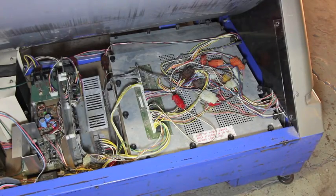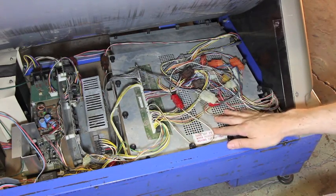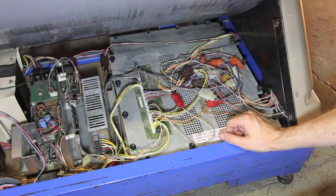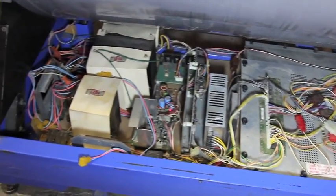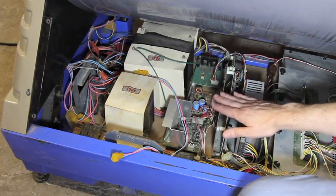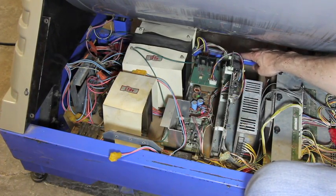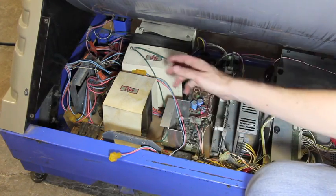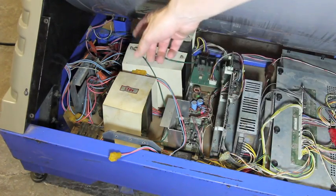Here we are in front of the game at the PCB cage. The PCB is inside this — there's a filter board on top and then here's all the wiring that goes to the various other parts of the cabinet: the speakers and the motors. Next to the PCB we have a power supply. We also have this drive board here. Back here we have the board with all the SCRs that actually run the giant motors, this is the sound amplifier, we've got a DC to DC converter, a couple of gigantic transformers, and then a fuse block and some more circuit breakers down over there.